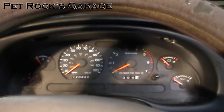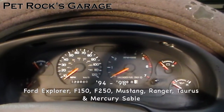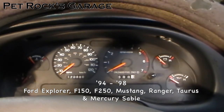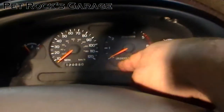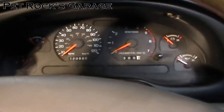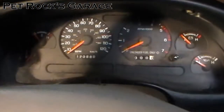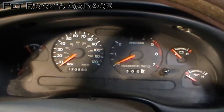While I'm working on my wife's 98 Ford Mustang, this fix also applies to 94 to 98 Ford Explorer, F-150, F-250, obviously Mustang, Ranger, Taurus, and the Mercury Sable. The problem is that inside the instrument cluster there are some plastic gears that control the rotation of the odometer, and they tend to get brittle and crack with age and basically disintegrate.